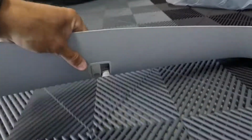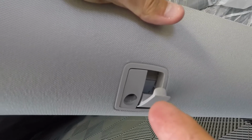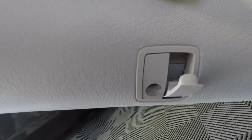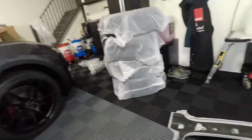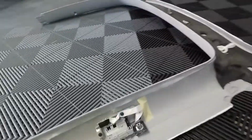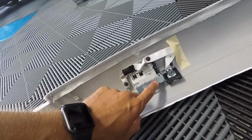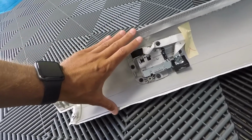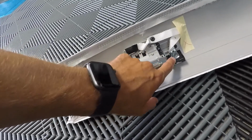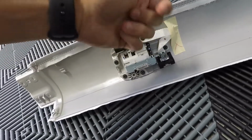The easiest thing is to remove a little shroud that goes around this. Pop that shroud off, because the door kind of sits behind it. Pop that shroud off, open the door, that exposes a screw. Take that screw out, and that's basically the backside of the light and the coat hanger. When you take that screw out, that releases this metal bracket from the liner, and the liner will drop out, and this metal bracket will be attached right here with this metal clip up into the car.